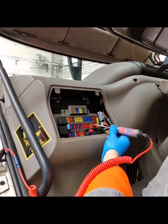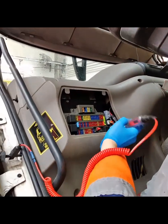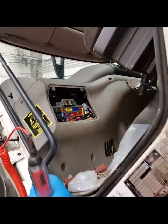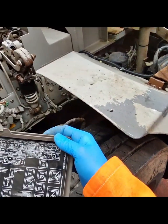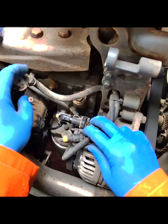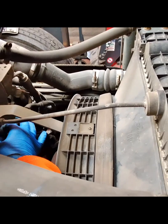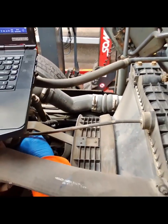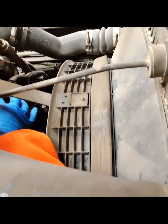Once I'd finally found the fuse, I was able to check both sides of the fuse for power and then I decided to check the diagram again — you just doubt yourself all the time. After verifying the fuse in the fuse box was okay for the alternator, I went back to RMI and consulted the data and then moved on to connector 307F.